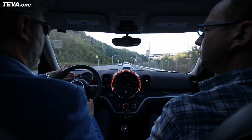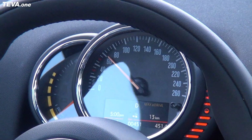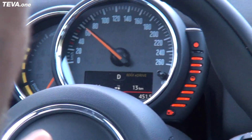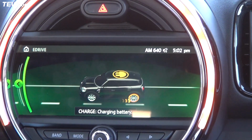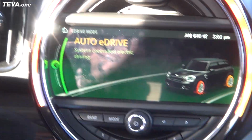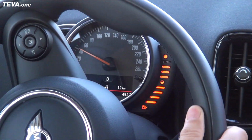So now this display was showing the power band, which replaces the old RPM display. It is specific to the plug-in hybrid, and it also changes according to the different modes. So I guess momentarily when we switch to auto, e-drive, and sport, the displays will likely change, especially when we go into a hybrid mode. Correct. Once we go to the highway, we can go to auto, so go down one. There you go. So now we're in auto drive, which will probably engage the engine as soon as we push it beyond the yellow range here. Correct. We'll see that on our eDrive analyzer there as well.